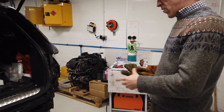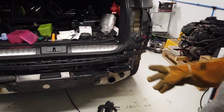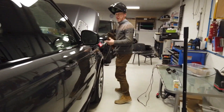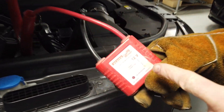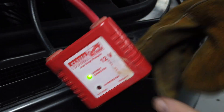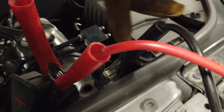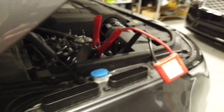We're going to have a go at welding this tip on. A couple of things: if you're welding an exhaust on a car, I would recommend using one of these little battery savers because of the stray voltage. We've got that on the battery charging points — ideally on the battery — but that will stop any stray electrical gremlins from upsetting anything.